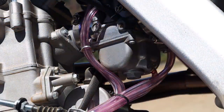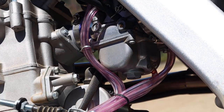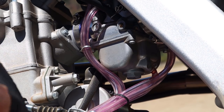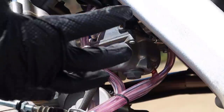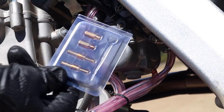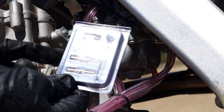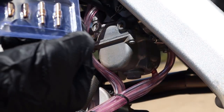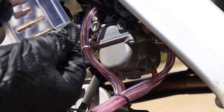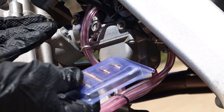All right, fellers, so we're gonna get in this carburetor. I'm pumped. I had some rubber gloves in the old moto van, as well as always some blue shop rags, because that's what moto vans are for. I suggest you try it. So this bike comes with two extra pilots, two extra mains. So we got a 165 main extra, 162 main, and I think it was a 42 pilot and a 45 pilot. So we'll see what's in here and see if we can actually even go up.